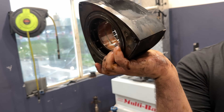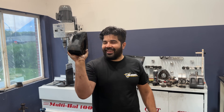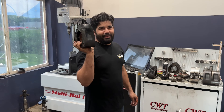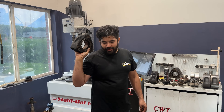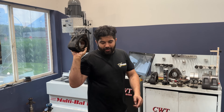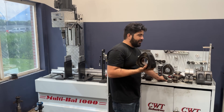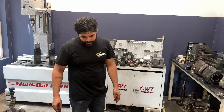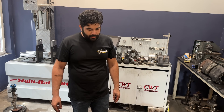That is insane. Usually you can get away with 5–10%, not 100% copper — that's like all copper. That's pretty much what we saw in the old reman. Maybe 110%. So this is the best-case scenario — if it had spun this bearing, it was about to destroy the plate, destroy the housing, destroy the gear, the rotor. It's a good time to open it up right now, because this was a maintenance thing. It wasn't about the power. Not the 5,000 miles we were looking for, but it's really good condition stuff.